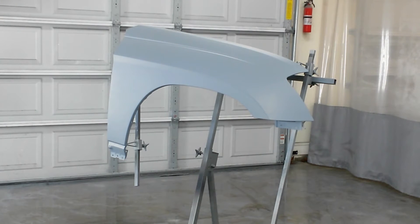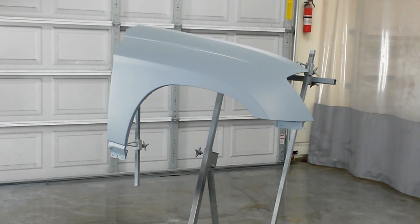Fender flashed for at least 20 minutes — I lost track while I was working on some bumpers, probably 30 minutes at least. I'm going to run the tack cloth over it real quick and just hit it with one coat of base around all the edges, then come back and do the front, the outside, and then let that flash, do a second coat and a mist coat or drop coat.